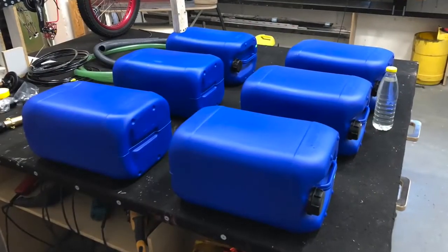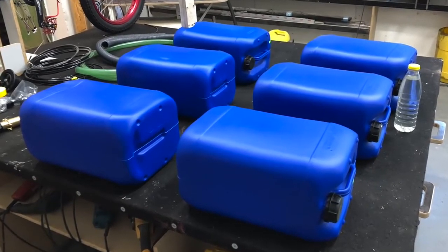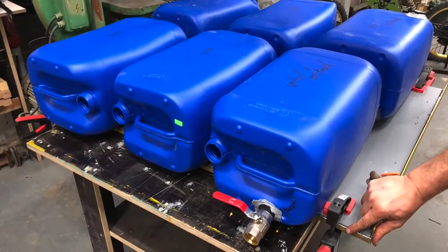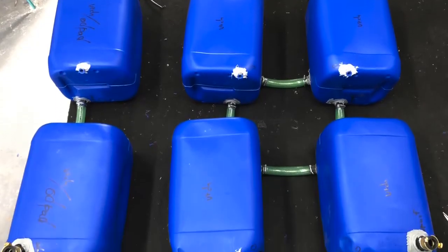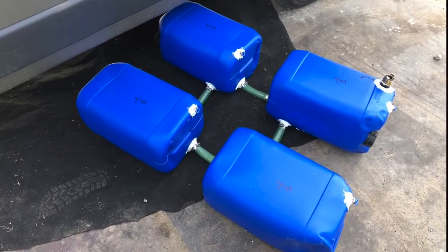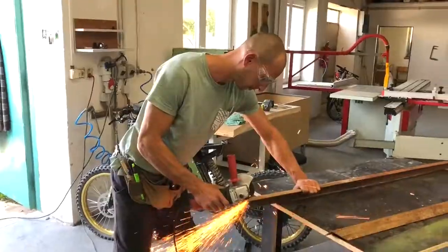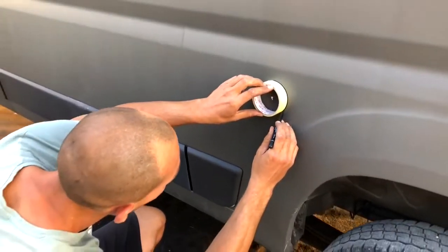There are plenty of pre-made campervan water tanks that you should use. I personally would never do a water tank inside a car if there is an option to have them underneath — the reason is of course space saving. I'm on a tight budget so I'm building my own tanks out of barrels. I'm connecting four 25-liter barrels together to create a 100-liter fresh water tank, and another two together to make a 50-liter gray water tank. These barrels fit perfectly under the car and I welded a supporting frame with a board so the tanks are covered, protected, and pushed hard against the car from the bottom.